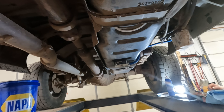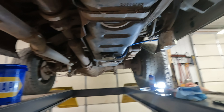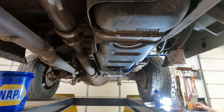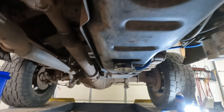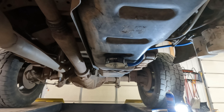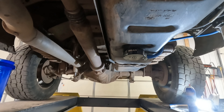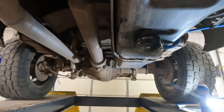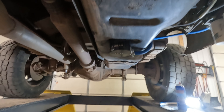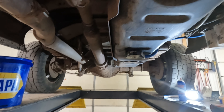This is specifically for a Ford Power Stroke 6.0, but you can use the same kind of rule of thumb on the Duramaxes and anything else you're putting a sump in. You can always look up top and see where your pickup tube is at and kind of make an educated guess from there based on the angle of the pickup tube. You want to try not to hit the pickup tube when you're drilling — that is very important. Some guys will take the tank all the way down, pull the pickup tube, and then drill their hole, and there's nothing wrong with that.